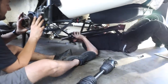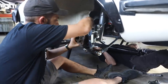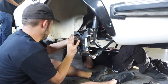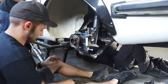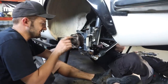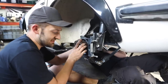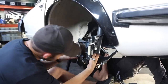This is our tailshaft — less than 24-hour turnaround, which is amazing. Last time we were adapting it from the R34 gearbox to the R180, and now we're going from R34 gearbox to an R34 diff in an R200. We measured it very carefully, so I'm just going to hope it actually fits. We'll also have to put on some new studs. We might pull this off and go again, change the bearing — we just want to piece it together to make sure everything actually fits, and if it doesn't we've still got time to get different parts.